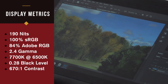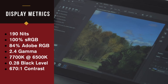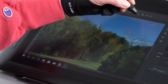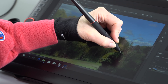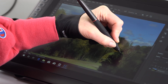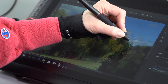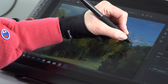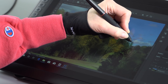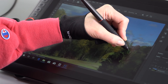It uses software settings instead of hardware buttons for color control. If I set it to 6500 degrees Kelvin it measures 7700 degrees Kelvin — much cooler — so you'll have to play around with those settings to get something fairly color accurate. If you're doing this for hobby purposes, who cares, but if you're a starving artist looking for the best pen monitor you can afford, be aware that you'll really want to calibrate this and keep an eye on color shifts. Also be mindful that if you're doing content for the web where sRGB is the standard, the wide Adobe RGB gamut might fool you — what looks wild and saturated might look a little funny on a standard laptop screen.